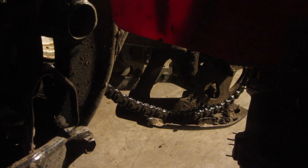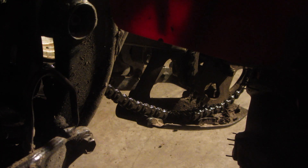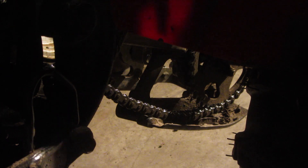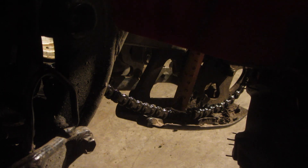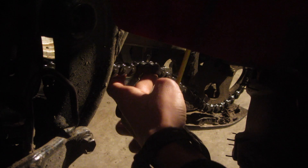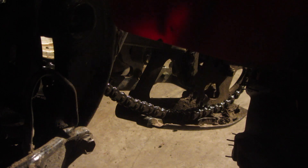I had a look to find the adjustment spec for this. On the forums I found for the Suzuki LT230 — the quad sport, or this is the E, but they're the same pretty much — it should be 40 to 45 millimeters from the lower run, and I'm assuming this is the lower run here. Right now it's at about 55 millimeters, which isn't good, so we're going to fix that.